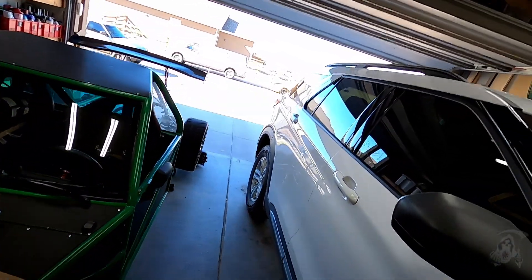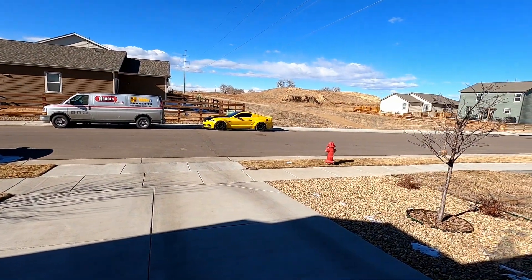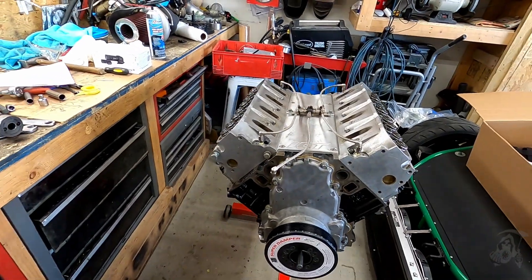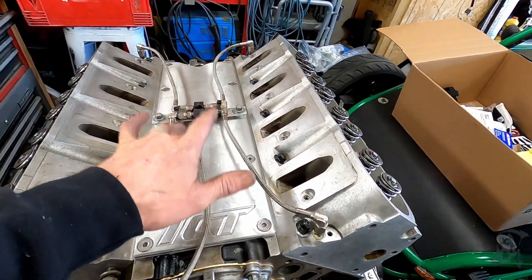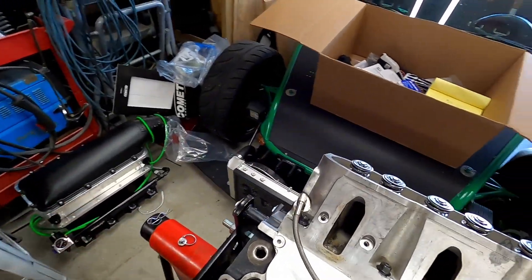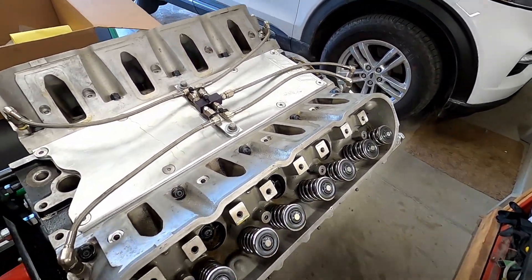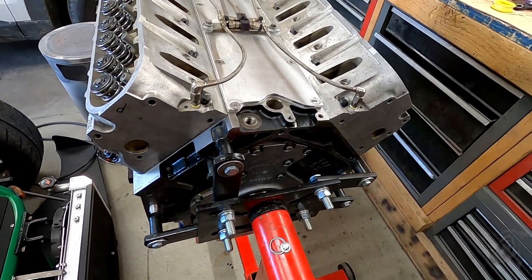All right guys, as you can see, Cole showed up — he's out there telling everyone about his car on TikTok. But I'm over here working. Got the heads on, all torqued down. Got the cover back on. Got the steam kit put back on. So all I've got left now is just to put a few sensors in the motor and then all the push rods and rocker arms. Spin test this motor, make sure everything's good. I know the timing marks are lined up identical to the way they came out. She's almost ready to go.